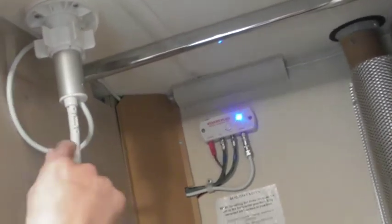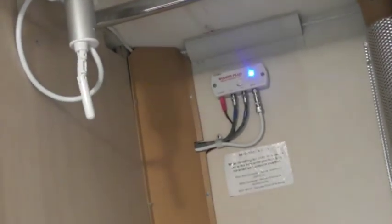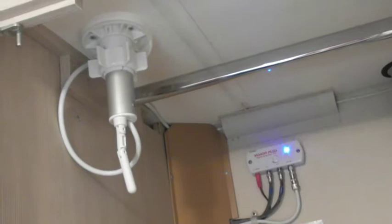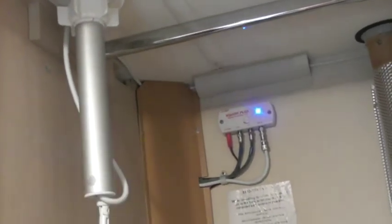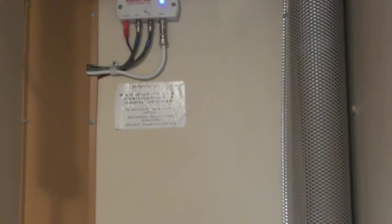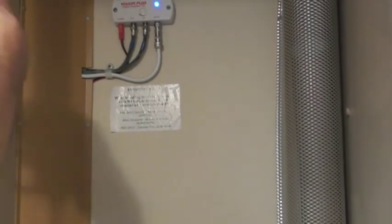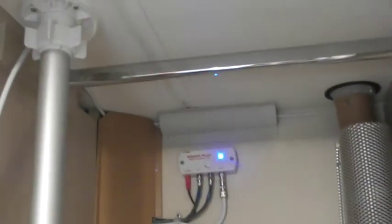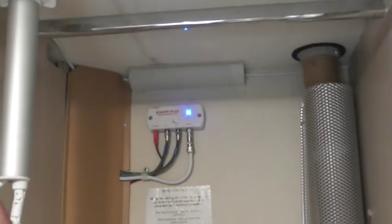You can change the angle of it by turning that. That will tip it up on its edge. So again, if everybody else is doing the same, you do that. But just make sure you flatten it and then bring it back down for when you're travelling. If you can see on that info note at the front, it says red dot denotes front of antenna. So if you spin that around and it's pointing that direction, then lock it off for travelling. At the back, you want it pointing that way for when you're travelling.